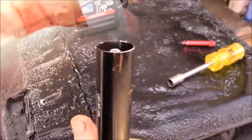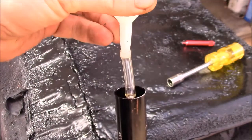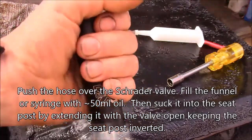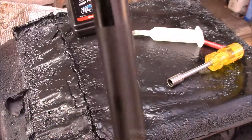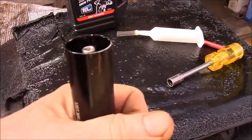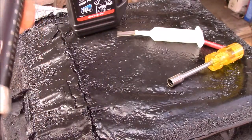I took a syringe — about 50 milliliters — with a clear tube that fits over the Schrader valve port. I filled the syringe all the way to the top and then used it like a syringe, pulling the saddle down to suck the oil in from the top. I cycled it a few times to get all the air bubbles out, which fills the entire post with oil — which turns out to be too much.